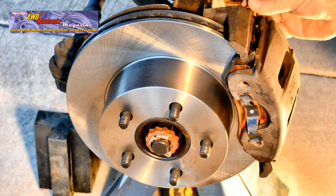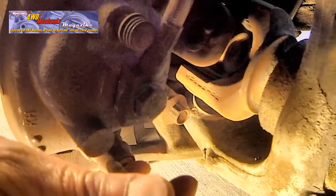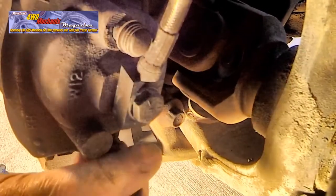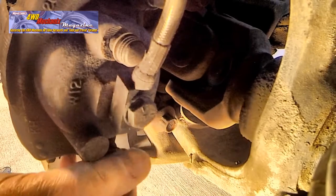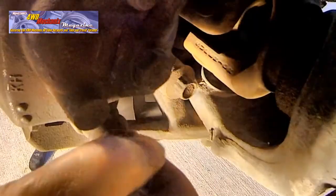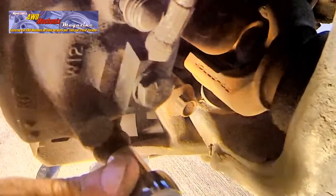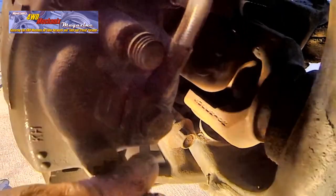These are fine threads. Start them carefully. Run the bolts in by fingertips and make sure that they are seated before applying wrench pressure. Here, I take the bolts up uniformly with a ratchet and socket. Make them snug at this point.